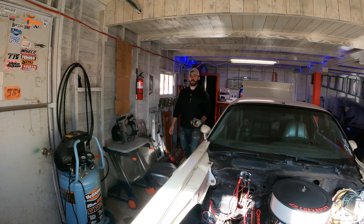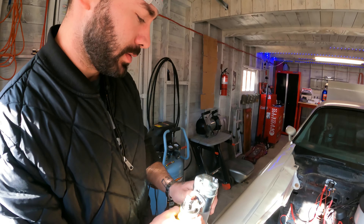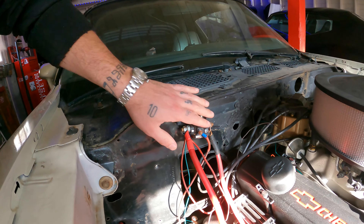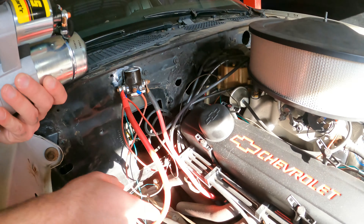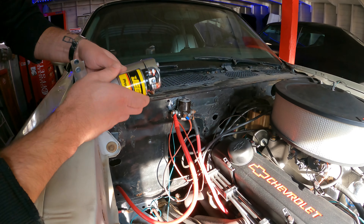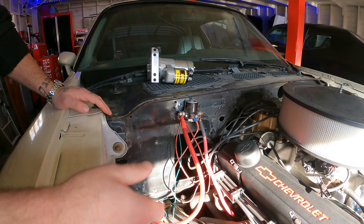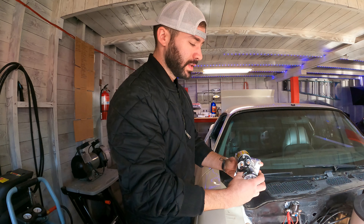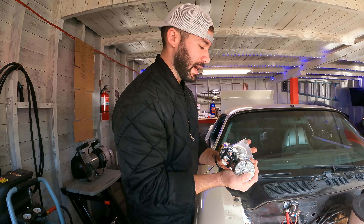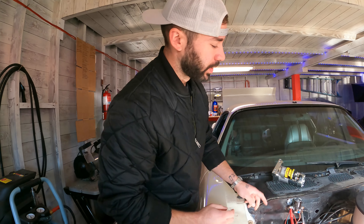Right over here, Jegs Performance high torque mini starter — this is the Jegs Pro Start. Over here we've got a solenoid. There's an aftermarket solenoid added to this car, and on the starter that's on the car they jumped the solenoid. They probably added this external solenoid because it was overheating — if it's a big giant starter it was probably close to the header and overheated. This mini one I'd imagine would not get as hot and probably be just fine, but we'll keep the external solenoid for now since they went through all the effort.